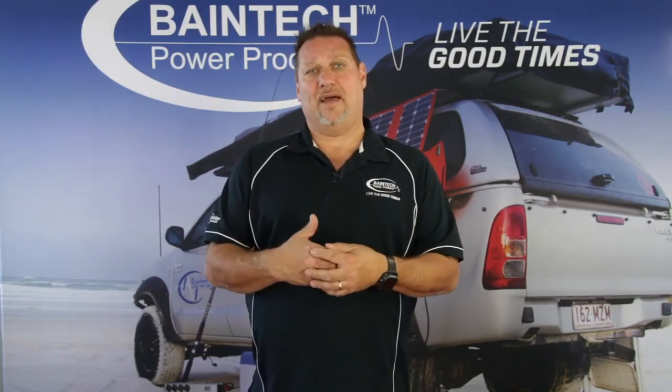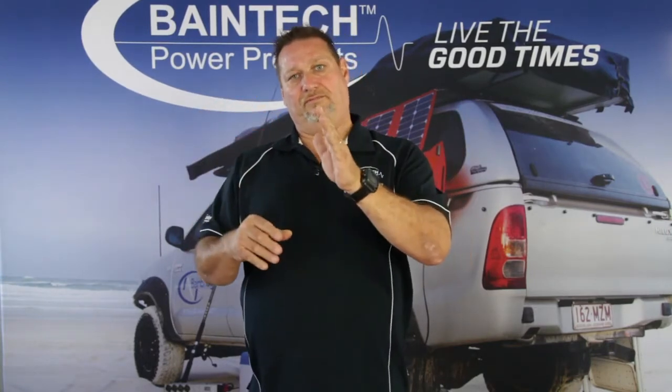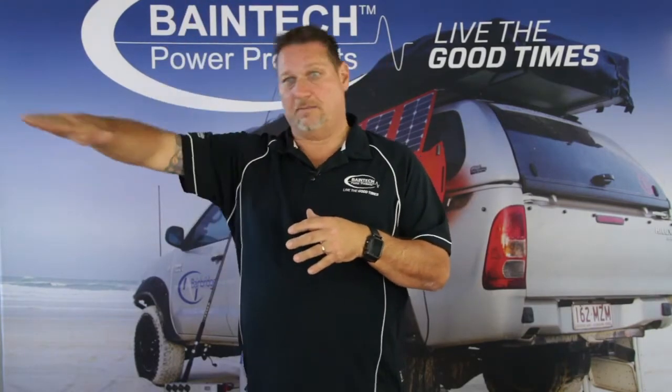Unlike a conventional AGM or lead acid battery, which goes through a charger that usually has quite a few different stages like bulk, absorption, and then float and storage, a lithium battery traditionally doesn't utilize that. So if you can put 60 amps of power into it from your alternator, it will take 60 amps until it's charged. Basically, it just goes straight up, none of this absorption, bulk, coming down, storage and so forth.